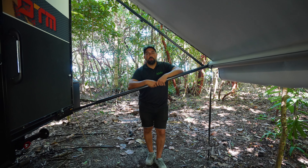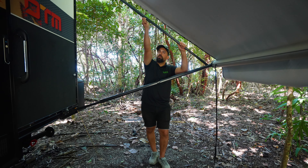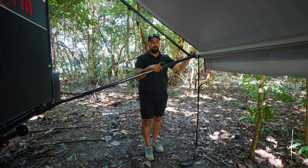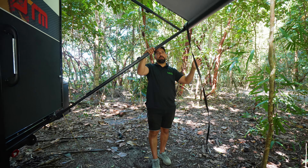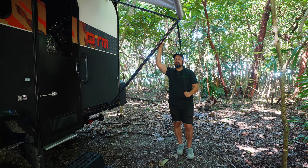The second way is what we call short arming. Re-loosen the roller of your awning arm, come back to the release lock system, put it in wind-up mode and wind up until the awning arm stops. This is what we call short arm — it's nice and solid. If you're stopping over for a day or two, it is a good, sturdy option.